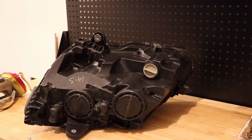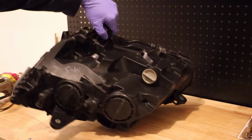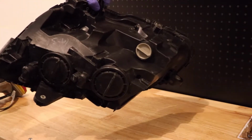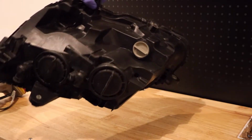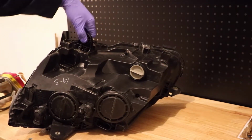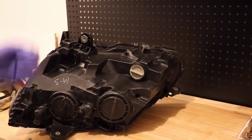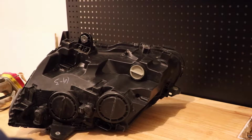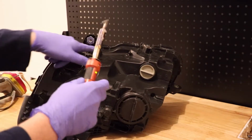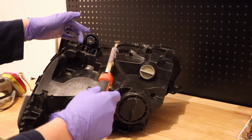Okay, so it's been about 3 hours. I've let this dry, and we can see that the JB Weld has bonded this strong enough to hold this tab back into place. But if we try to bend this with a moderate amount of force, it will snap back off. So we're going to take our welding iron here and come around the seam and weld it back